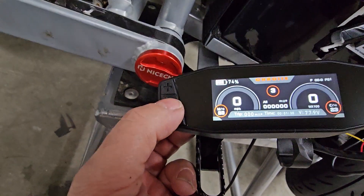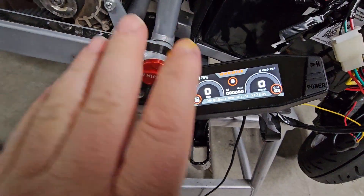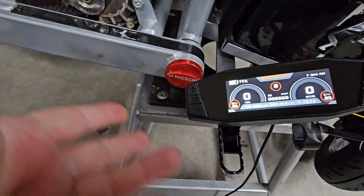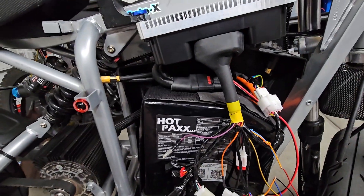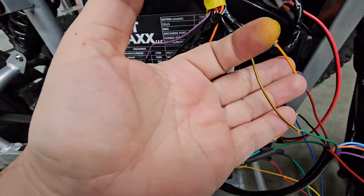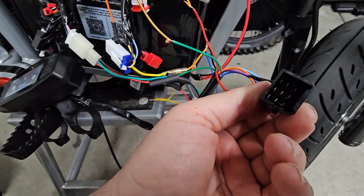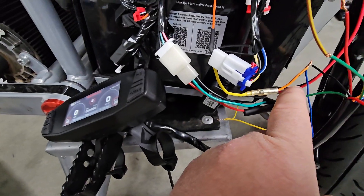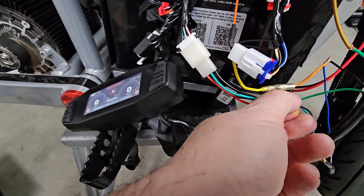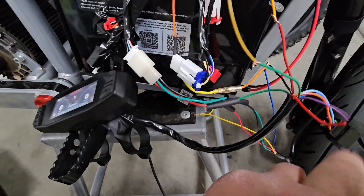Anyway, it took a while to figure this out because nobody can explain it. To use this display to get real-time information, you just have to use the CAN bus on the Fardriver — but you also need a Fardriver that's CAN bus-enabled, since most of them aren't. Then you've got to hook up the two wires, CAN high and CAN low. I had to chop the connector off because I couldn't find a matching one. Other than that, the display just needs the green wire, which is ground, and the black wire, which is battery positive — yes, very intuitive. The rest are just turn signals, headlights, etc., to get the display to show other things.